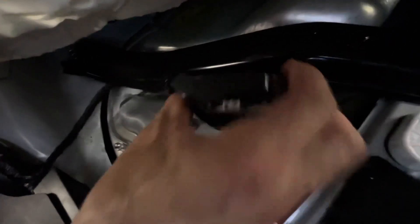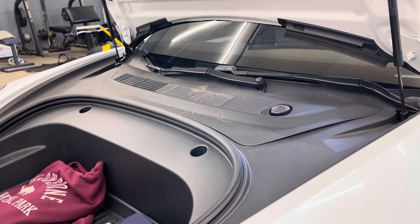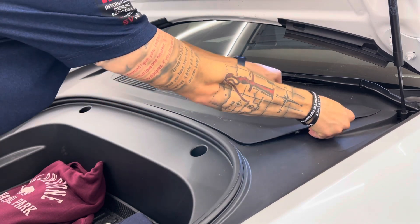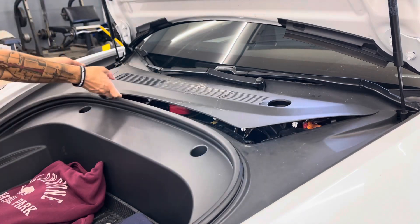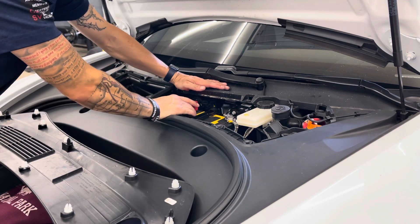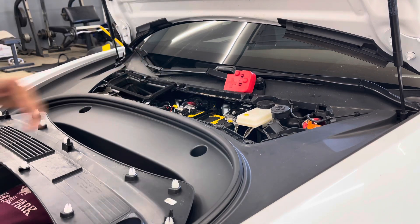Set that to the side and make sure it's not connecting anything — you'll reinstall that later. For the removal of the 12-volt battery, it's actually fairly easy on these Teslas. This comes off really, really easy — I've already taken it off a couple times. Slowly work it up; you don't want to be yanking anything super hard. It exposes the battery. You've got your 10-millimeter for negative and your 10-millimeter for positive. Take off the negative first — that's very, very important because you don't want any arcing.